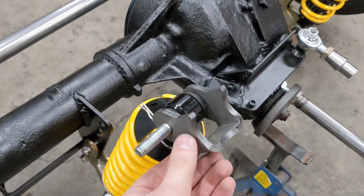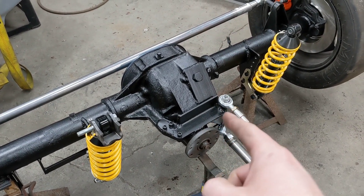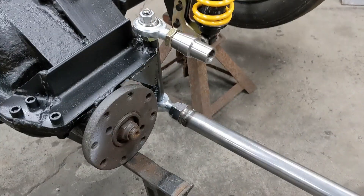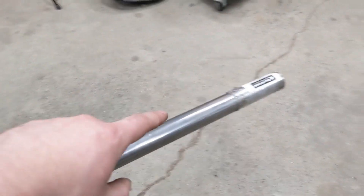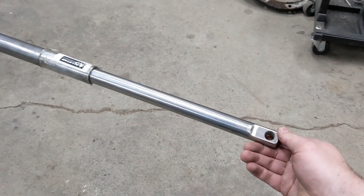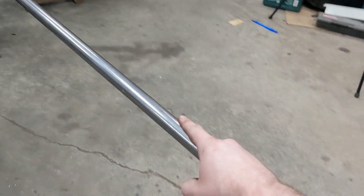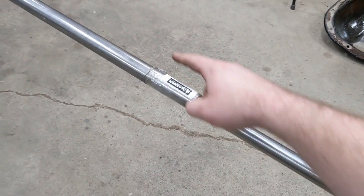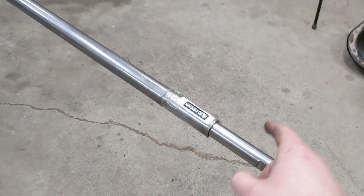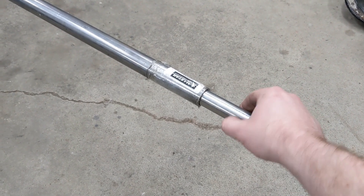For the coil overs, I've got these mounts and I'm going to build a bar that goes from side to side and weld that into the car. I took a whole bunch of measurements and these should fit. For the torque arm itself, I've got a bar here — I need to figure out where the trans cross member puts everything, cut this to length, take another bar, connect it to the front. This piece of rod I have here I'm going to plunge in whatever the length ends up being. The bar that comes up from here I'll cut, weld it to this piece, and make sure this bar goes well past the point where it becomes one. This is solid one-inch steel.